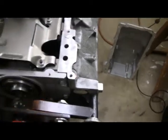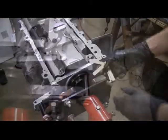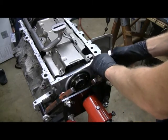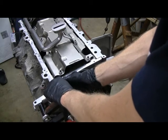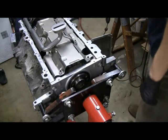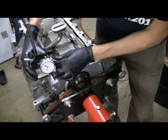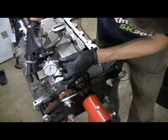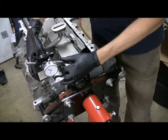GM makes some fancy tool you bolt on here for getting the cover centered. Obviously I don't have that, so I'm just going to use a feeler gauge. 10 thousandths is what I was going for, 20 is the max it can be below. As I try the 10, I can feel that it drops down. The 20, I can feel that it's high, so I know I'm in between. Same thing on this side. What I wanted to do is check with a little more accuracy, so I checked with my dial indicator. I put it on the rail of the block and essentially zeroed it out, then I just drag it over to the cover and it drops down at 14 thousandths of an inch. So I'm well within the tolerance.